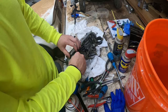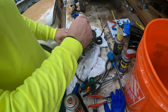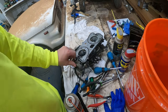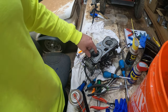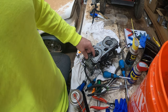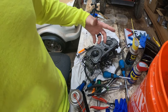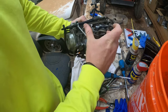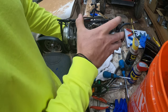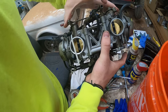Some carbs will have that little bracket that the hoses slide into, some won't — but this one does, so why not use it? If you've reached this point, congratulations — you have a rebuilt GL1500 carburetor. The vacuum-operated pistons are moving freely now, the throttle linkage is snapping back with a vengeance after being seized. So this rebuild was successful.